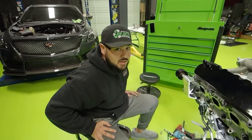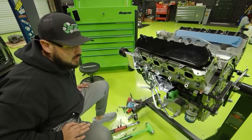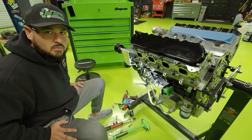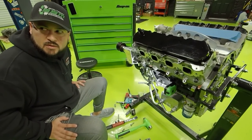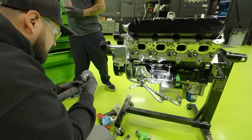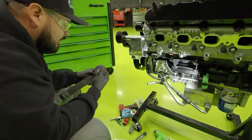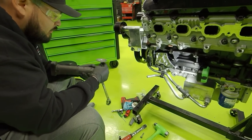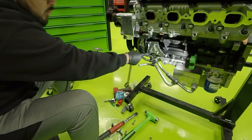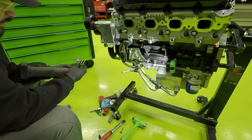I haven't had good luck with LME in recent years — that's why I'm working with Texas Speed now. But this bracket, they make it and I said forget it, but it proved me wrong again. They proved me right that LME ain't it. I would have rigged up something on the stock bracket if I'd known I'd have to rig this billet bracket up too. I'll pull it off and measure — the studs they sent are just a little too long on this one, and it's hitting the back of the bracket, so I'm about to cut it.